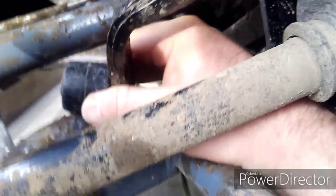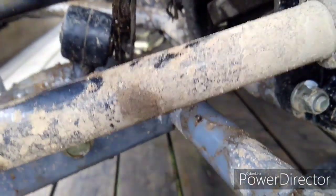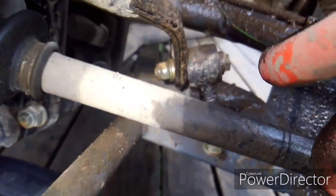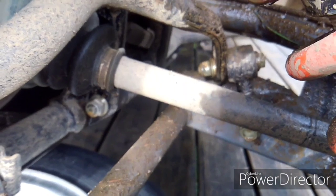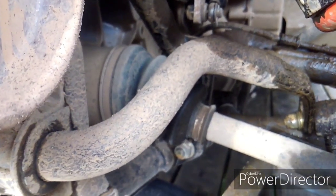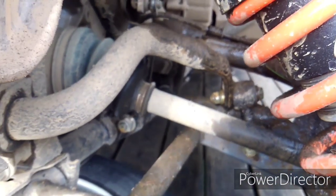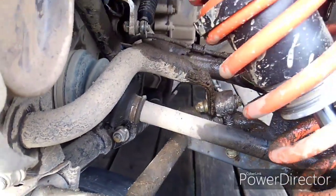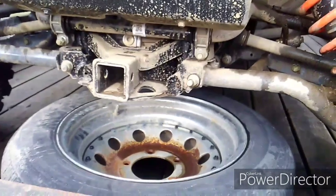But that's kind of ridiculous. You see over here on the other side, it's pulled down flat on this side. Well, boy, when those things go into twist, I mean, look at the size of that sway bar. You're supposed to have 14 inches of travel, and all I did was easily roll through a little area that articulated the suspension and snap that bolt right off of there.